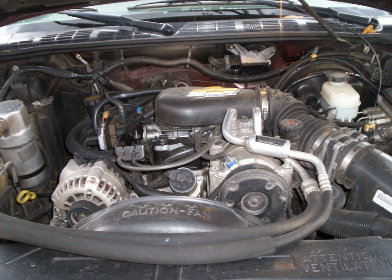The timing cover flange area was thickened in 1995 when some balance shaft motors had a six-bolt timing cover. Some engines had a crankshaft position sensor in conjunction with a redesigned distributor containing a pickup assembly functioning as a camshaft position sensor, when OBD II was phased in. The L35 was standard on Chevrolet Astro AWD vans and optional on 2WD models, and was standard equipment with the S10SS and Sonoma GT.